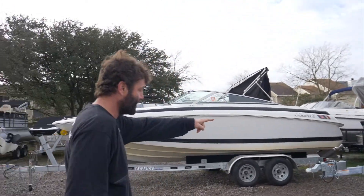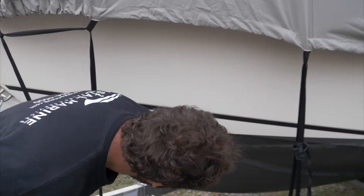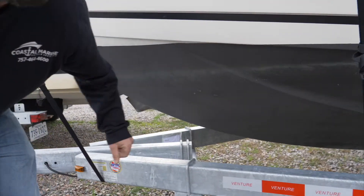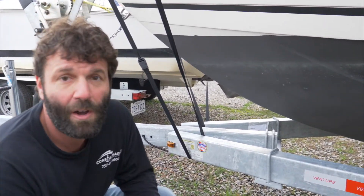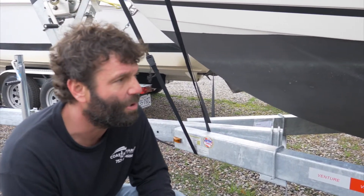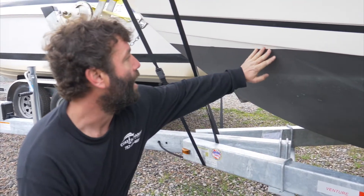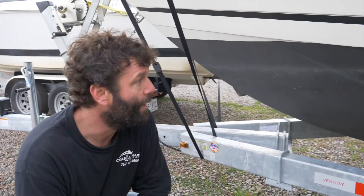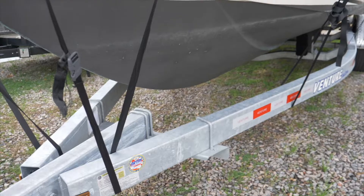You can see we actually put a bottom on this boat not too long ago. These are Interlux products — that was the Pacifica paint I was talking about. This bottom came in and it had been sitting in the water for a little while, but we gave her a nice good sand, took all the nasty stuff off the bottom, all the shells, all the barnacles. Gave it a nice pressure wash, then we put a nice epoxy primer on there and then several coats of bottom paint. You can see she's nice and thick and durable.